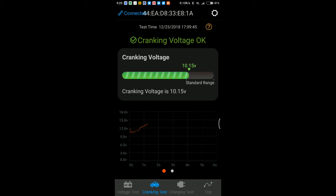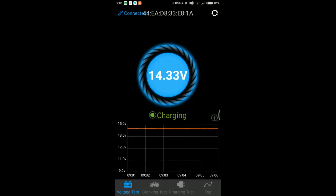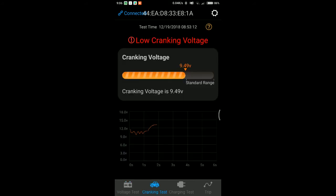It gave me a warning. I thought it was the battery because everything else seemed fine, so I went and bought a new battery and wasted my money. It turned out it was the starter motor just drawing too much power. So if you get a low crank voltage, it's probably your starter motor playing up. Currently the voltage test is showing 89%, so that's fine. I'll show you a little video of what I did originally where it showed a low crank voltage.